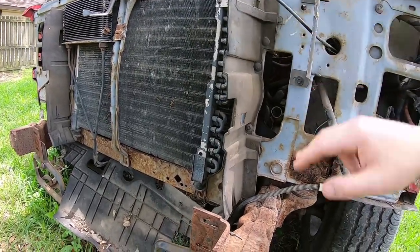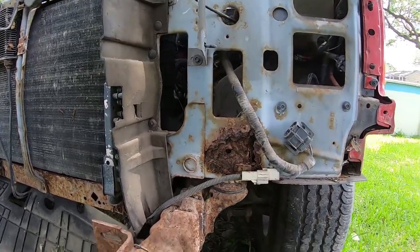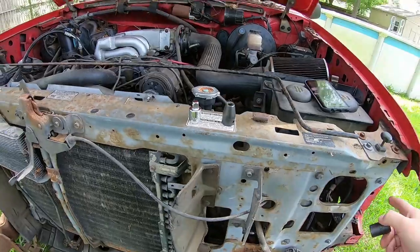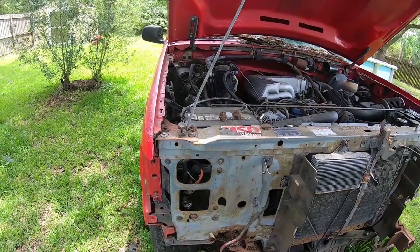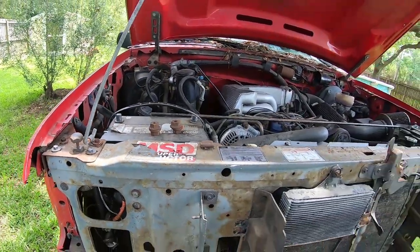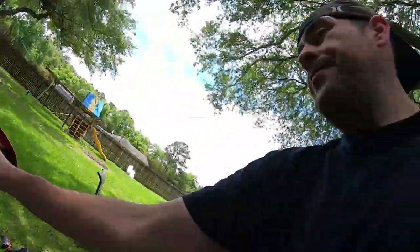Going through these little 10mm bolts. This is the body mount bushing that will give everybody problems - you see the gigantic rust spot. That is a 15mm, I believe - it might have been a 13mm. Looking down here, you see the top of that bolt. I believe it's an 18mm bolt that goes on top of that core support. By removing those - this bracket and that bracket - we should be able to remove and free this core support.